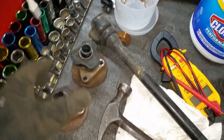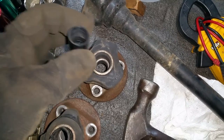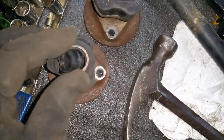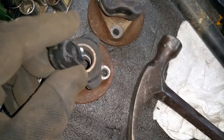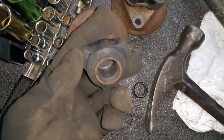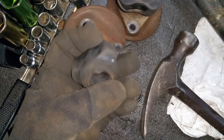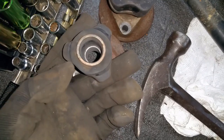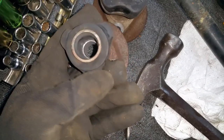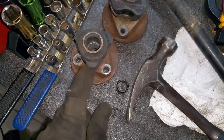Here we are on the bench — I just wanted to show everyone the dampers. Here is the rear damper with the collet inside. This one is actually in pretty good shape; it still has most of the rubber material, and this is what centers it. Over here is the one from the flywheel — I did break this, but it's an easily replaceable item. On the front damper, we caught it just in time. It still has its shape with the outer spokes, but you can see where you're starting to see bare metal. Eventually that would wear out to the point where it starts to slip. It seems to favor one side, so it will start to flatten out on one side, and then one of the other sides will remain okay — it will start to pivot inside. Eventually you'll start feeling vibration, and that is a good indicator that you need to replace your dampers.